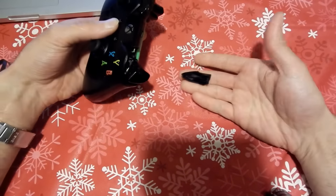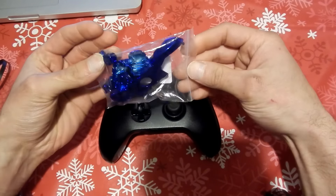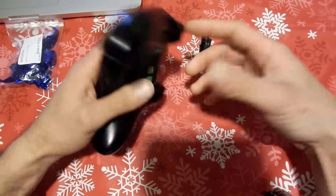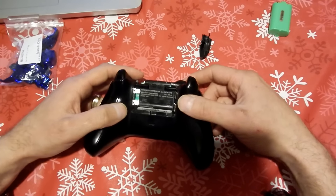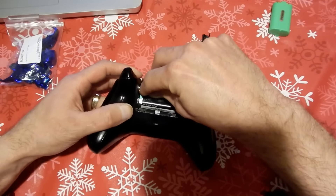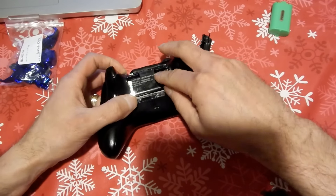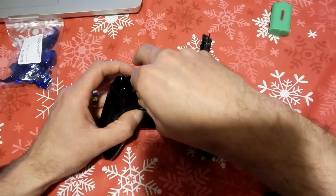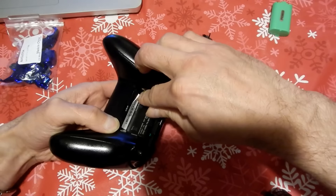As you can see, my old buttons are flying off my controller — there goes my right button and the left button is loose as well. That's mainly why I'm replacing the buttons, but I also want to change all my buttons to metallic blue, which will look cool. We're going to start by removing the battery, then peel off the sticker on the back because there's a Torx screw — a T-bolt — hidden underneath. I've seen T8, T10, and T12 depending on the controller, so find the right Torx bit.